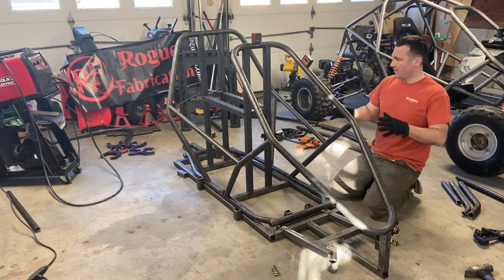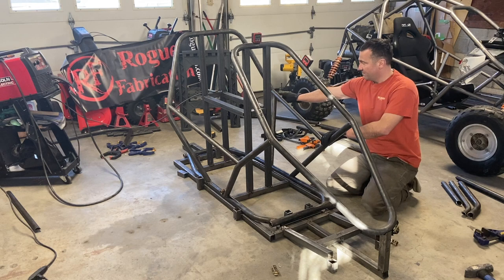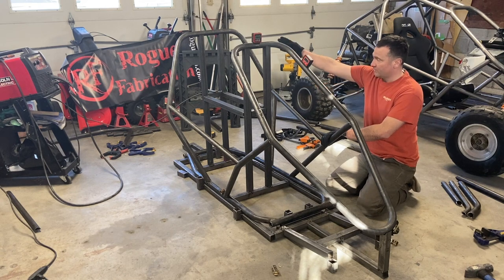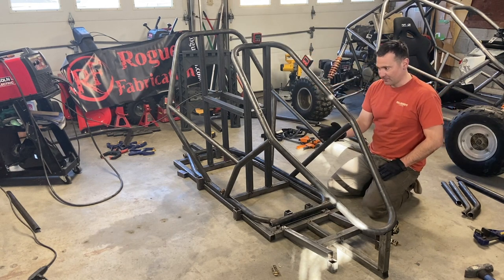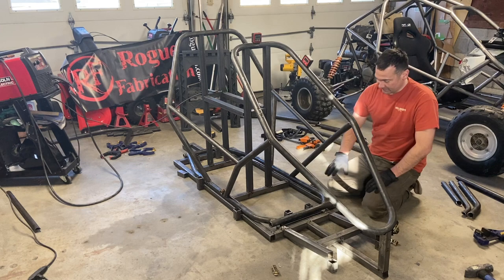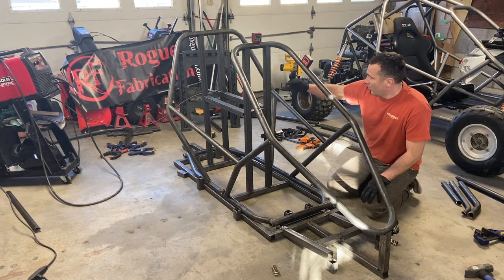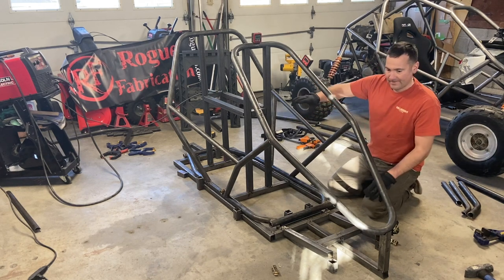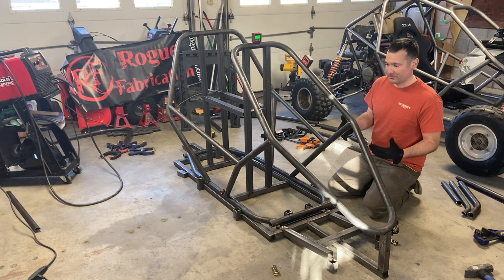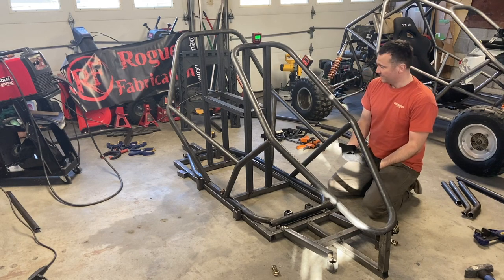Something else you can do is use the cross members to align everything. The rear cross member goes just above where the pipe or bend starts to go straight toward the roof, and this one sits at the center of the bend. Put both of those in place, measure the angle from the ground — since we're working off a jig — and when that angle matches, it's in the right place. If those four points line up and the angle is straight, then you've put these pieces in the right place. I designed the chassis that way to make it easier for assembly: if the right is squared to the left and the cross member lines up, the whole frame stays square.